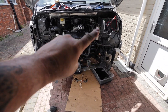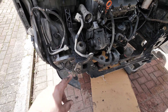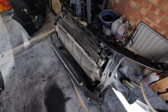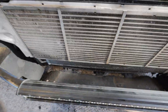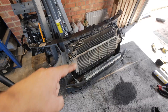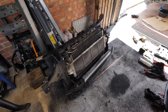I'm at a point now where I've got the whole front of the van off. It was fairly straightforward — just a few bolts there and down there, undo all the pipework, and the front pulls off all in one piece. One thing I noticed while I'm here is I've got a bit of a bent radiator — you can see it right down there at the back. While I've got this off I might as well change it. If I don't do it now, within a couple of months it'll be leaking and I'll have to strip the whole front off again.